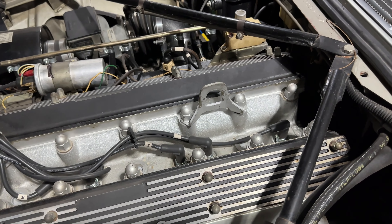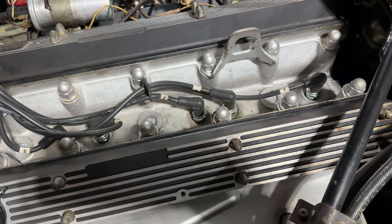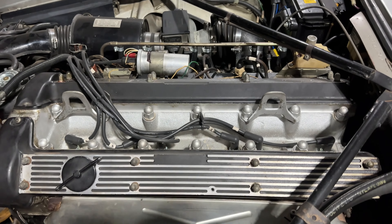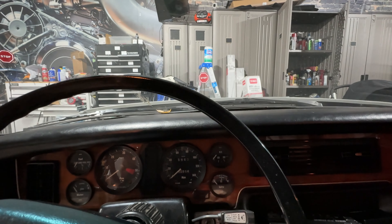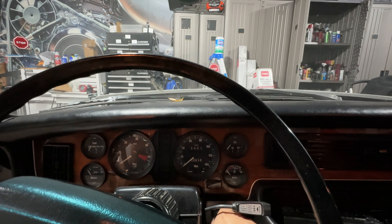I'm going to take the rest out and put in the new ones and we'll see if it runs any better. All right, all the plugs are in. Jaguar motors are notorious for being unreliable, but if you are a beginner, there is probably no easier spark plug change engine than this inline six cylinder - everything's right up on top. Now let's just see if this thing runs.